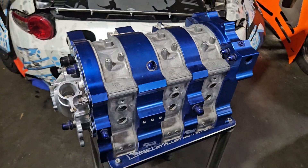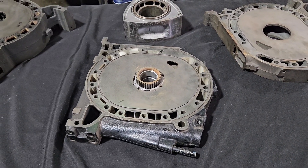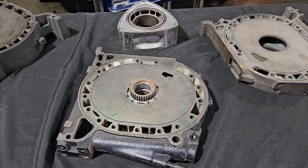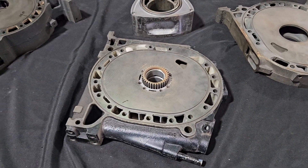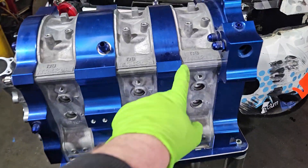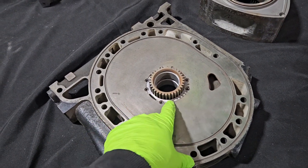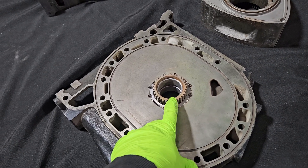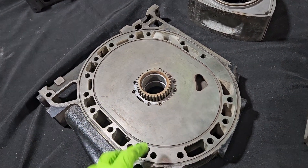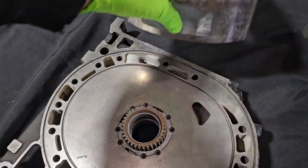When we jump into four rotors, Mazda never actually produced four rotors readily available to the public, so essentially 99% of all four-rotor builds we see today in drifting, drag racing, hooning, and car shows are aftermarket builds. How that's done is you take an OEM 13B thin plate — kind of like that one right there if it were aluminum — and then you make a bearing carrier that allows you to take an OEM stationary gear that's been modified and insert it into that OEM thin plate. You can see it's got set screws controlling positioning, rotation, and timing relative to the shaft lobe.